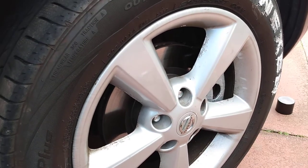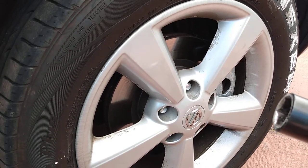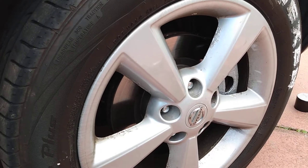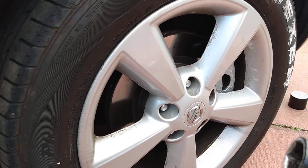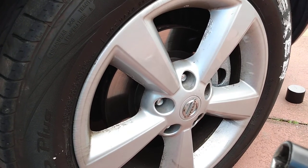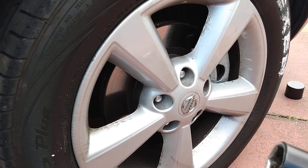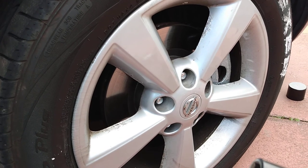You can use that in the standard car wheel brace. You can use the car's standard jack as well. If you've not done it before, if you've got a spare wheel, then I'd recommend putting the spare wheel under the brakes, just in case the car does drop, it's got something to drop onto, not from a great height.